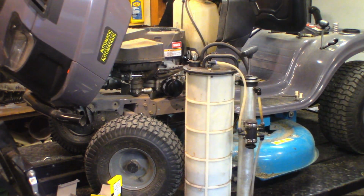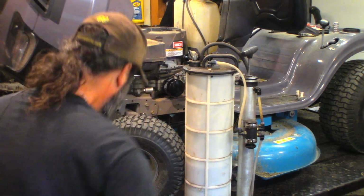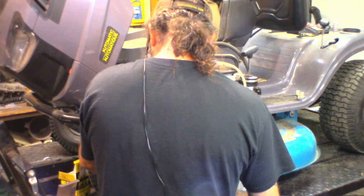But what I normally do is I'll do this while I'm checking tire pressures. There, we'll let that run. Tire pressure is usually 10 in the back and 14 or 15 in the front, usually. Not for highway service. 14 PSI is rated on the side wall of the tire, and we're gonna make sure it's there.